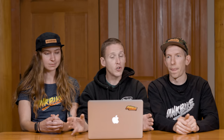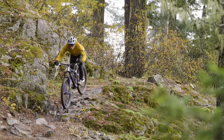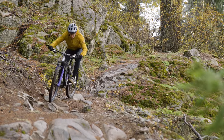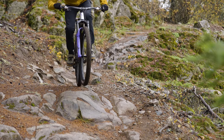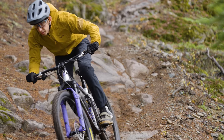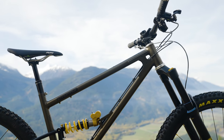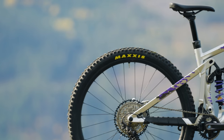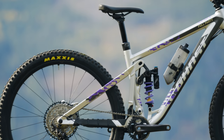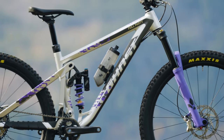Execution was a little lacking, and it just resulted in a bike that was pretty hard to get along with. Let's boil it down to what actually is wrong with this bike. I think the head angle is too steep — it's a 66-degree head tube angle, and I think they could have slackened that out to give it more of that downhill ability that it looks like it should have. It's on the heavier side, 36 pounds. It's got a coil shock, but that's still two pounds heavier than the steel bike we have with a coil shock. 36 pounds is pretty heavy for a 140-mil bike, and that's enough that it does make a difference on the trail. The geometry is also a little bit off for the sizing — super fit geometry. It wasn't quite a super fit for us. You could potentially go with the size large, but then you end up with a really long seat tube length, so there's a lot of stuff that just doesn't quite come together.